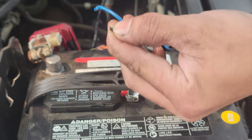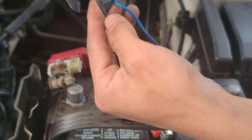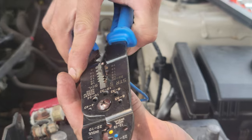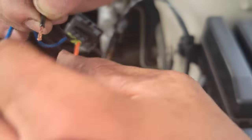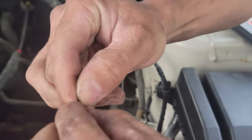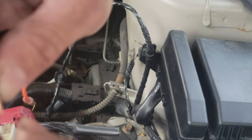I'm cleaning the middle one off from cutting so that the butt connectors can fit properly inside that sleeve. Like I told you, it's going to be as long as the cut line. We're going to put in the splice butt connector — it was on, I think, 14 gauge — strip that. It's been stripped. Twist it counterclockwise as much as it can go, just twisting the tip until it's nice and tight. I want the connection to be good. This is just copper, so make sure it's all straight. The more you twist, the tighter and shorter it gets, which gives it a better chance of connecting.